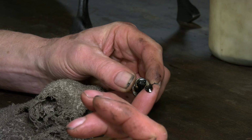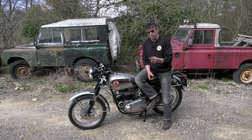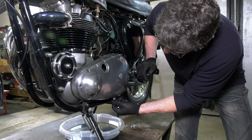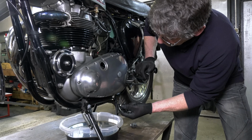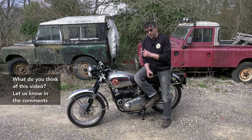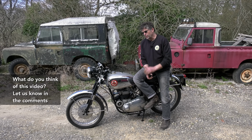And if it's bad, then you have cause to look into the engine maybe, or maybe it's not quite what you thought the bike was. Primary chain case oil, change that as well. Fork oil, it's not a bad idea. I run these on slightly thicker oil, like 20/50 oil, not your modern fork oil. But you do that sort of thing first.